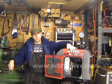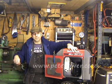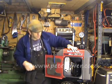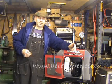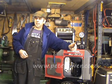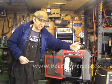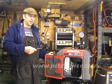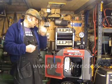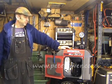You might get a freezer that's only 400 watts, but it might need a 2.4 kilowatt machine to actually get it started, and then after about half a second, all it needs is the 400 watts. They get used a lot for these situations — burger wagons and that. They start the fridge, and once that's done, just tick it over running the lights. The fridge switches off and it's literally just the lights. That can be a problem for any generator. I call it light loading — the load is nowhere near the rated load of the machine.